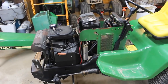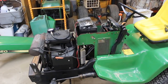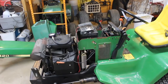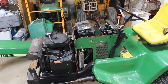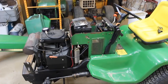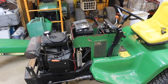There are two ways you can do this. This engine is kind of warm — it ran for about 10 minutes about a half hour ago, so the engine's still relatively warm. You can do a cold test and then a hot test. Or you can do a cold test and then put just a couple squirts of oil in the cylinder. That'll basically tell you if the compression improves, and the amount it improves will tell you the health of the engine — the health of the rings.